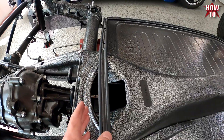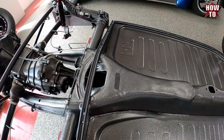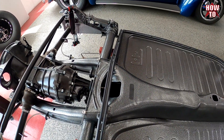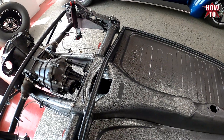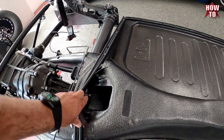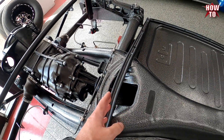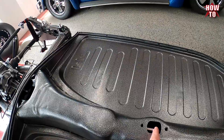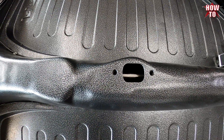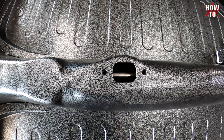Which means that if we had just built it based on the distance that we cut the chassis, then we'd probably be an eighth of an inch short, or some configuration of millimeters or eighths of an inch. So what we're going to do is put the shift linkage in the tunnel. We're actually going to hook it up to the hockey stick here with the little square drive grub screw. And then with that in place, we'll have a center line of where we need the shift linkage. That will give us the exact amount we need to trim. Then we'll trim it, weld the tack head in, put it back in, and see if we're good to go.